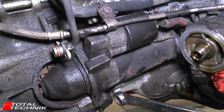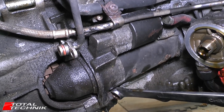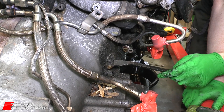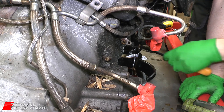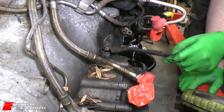For the next stage, at the bottom of the starter motor here is a size 16 bolt just there — let's get that one removed. Next up for the starter motor, we've got this one which is kind of facing the opposite direction to the one we just took out, which was facing forward. This one's going into it from the other direction, just here.